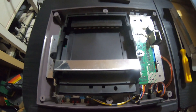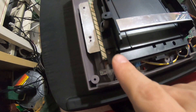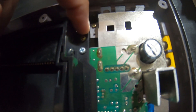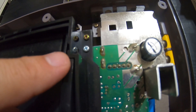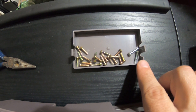The next step is to take out all the screws to remove the tray and then the final two screws to be able to lift up the motherboard and everything. We're going to remove eight screws total. Now notice on the back part of the tray on each side, there are actually two different color screws. The one in the back is the same as all the other screws in the system, but the different-colored one is a little bit longer — so those screws have to go back in that specific location. Those are the only two screws that are any different from all the others. Now we've got all the screws extracted: the regular ones, and just those two silver ones that are a little bit longer — they go in that specific spot on the tray.